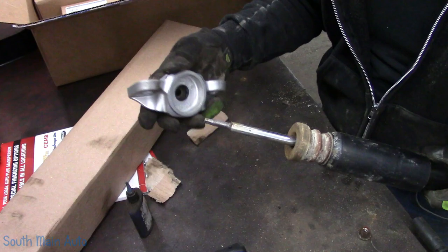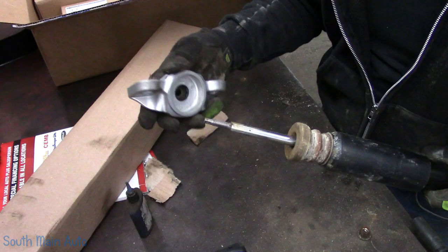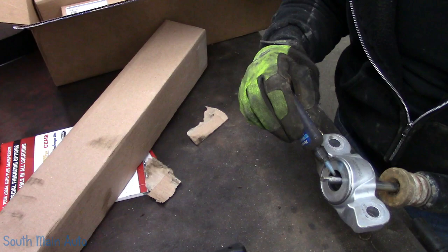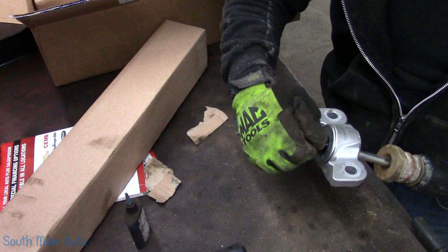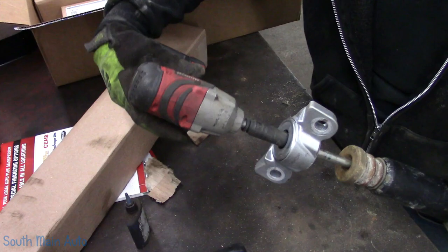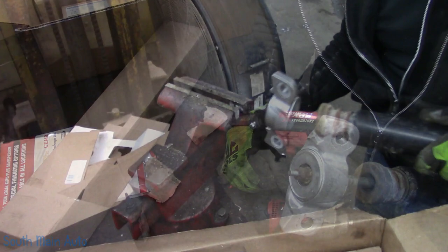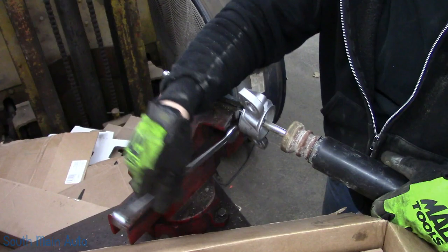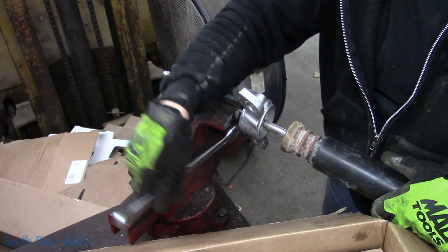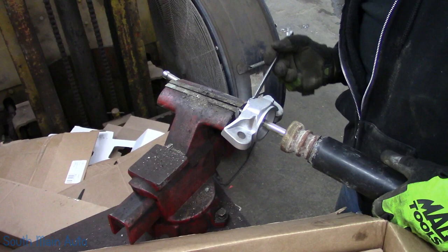Because we are reusing a nylock nut — which will drive the audience absolutely bananas — we're gonna put some blue Loctite on there, don't you worry. Get a little toot on. Now we're gonna take it, hold it, tighten it up with a wrench. Stick it right in the vise, hold it on the end, wrench it on the rest of the way. You can still feel the nylock just gripping — give her a good squeeze, snug it up.